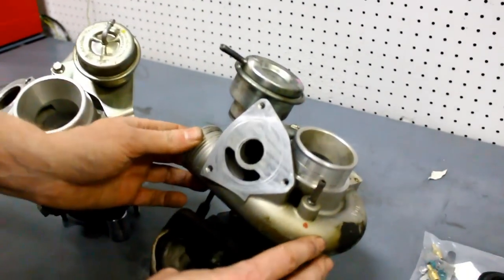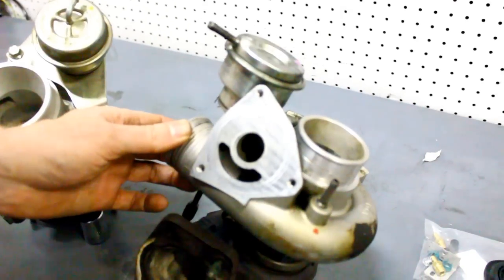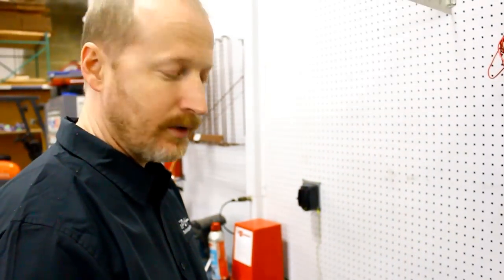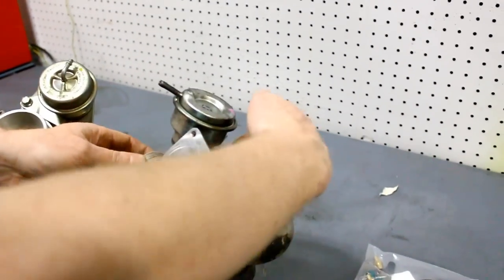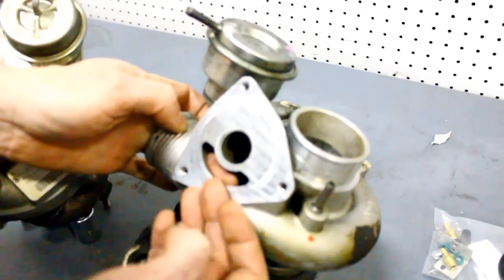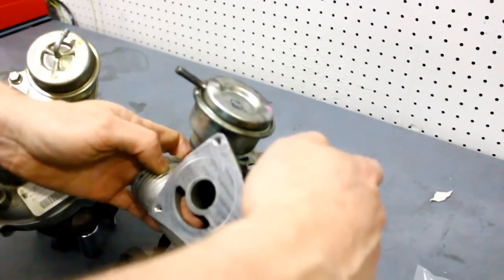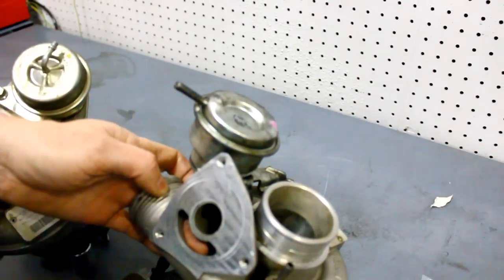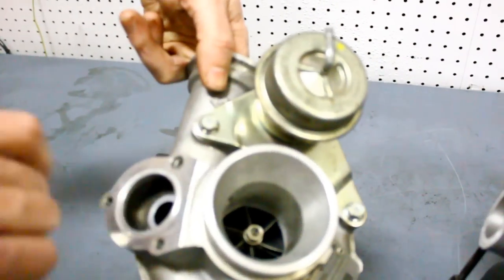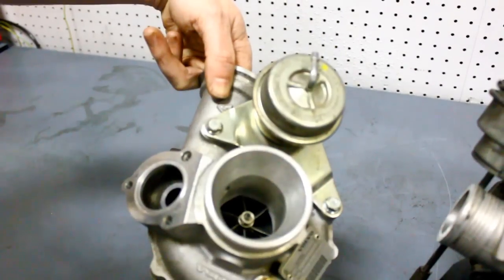The primary function of a bypass valve is to take that surge — what most people would think of as a blow-off valve in racing applications — and recycle it without dumping it outside the vehicle, so that you maintain running quality with the car. The turbo makes pressure where it exits, and the boost needs to escape from that high-pressure area and exit back out pre-turbocharger at your inlet pipe to avoid surge. On the Triple K, the boost comes out through the center hole and exits to the outside, then comes back to the inlet of the turbo.